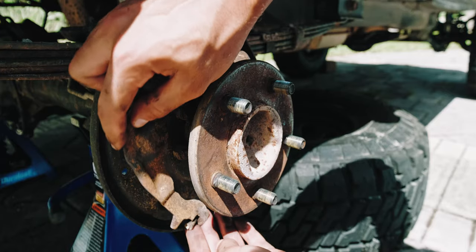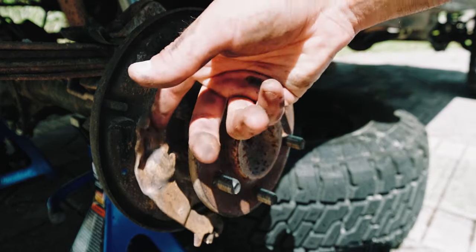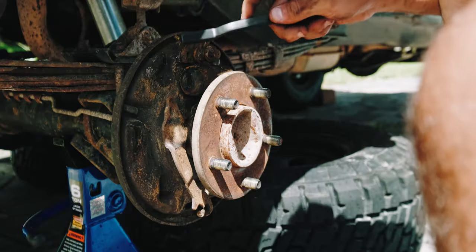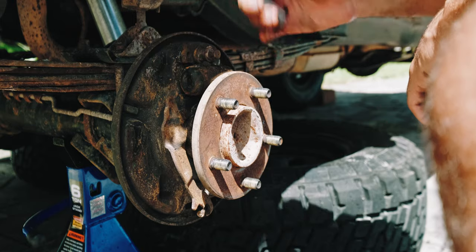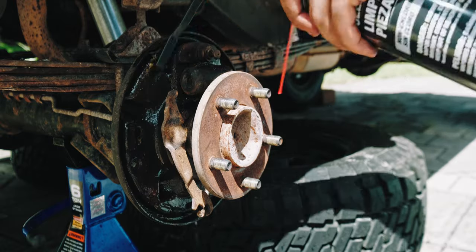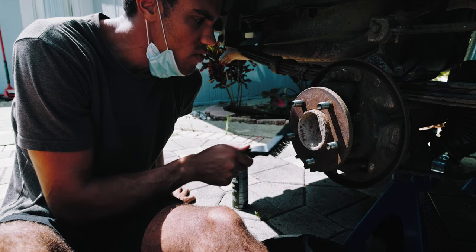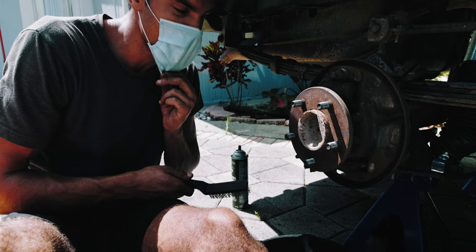This is similar to what Chris was looking at for the parking brake, so he takes this off. I might just leave it on since it's going back in anyway — just clean it up since it's dangling there. Now I'm at the part where he sprays everything down with brake cleaner and uses a wire brush to clean everything off, get the rust off, and get the contact points cleaned up. It's probably not a good idea to inhale the crud and dust coming off — part of it's rust, part of it is brake dust — so I have a mask.